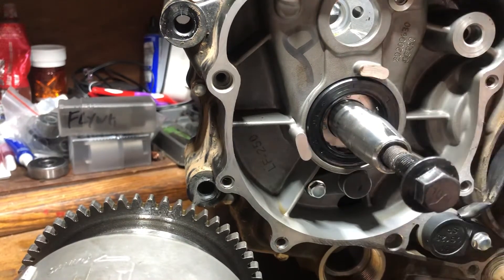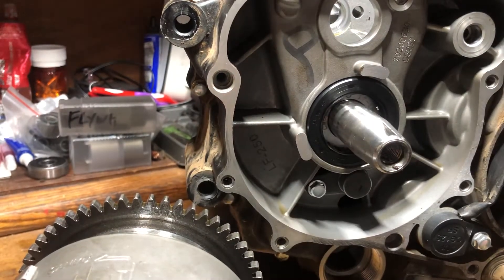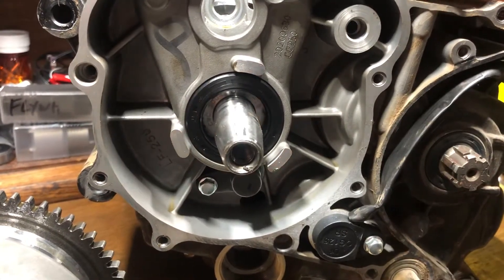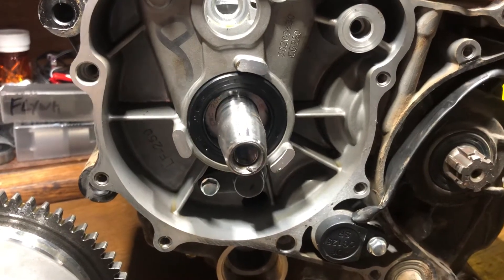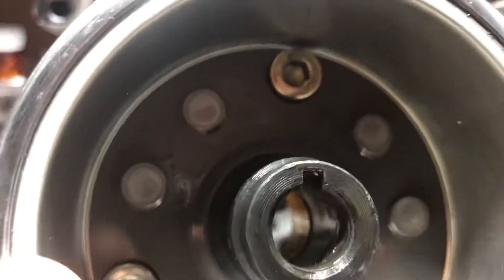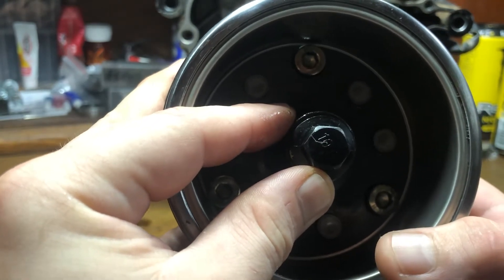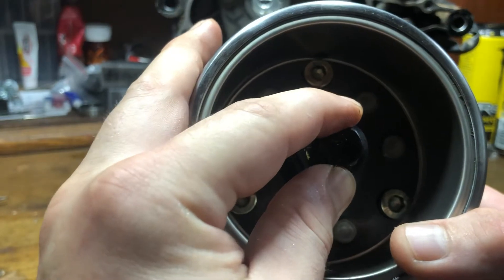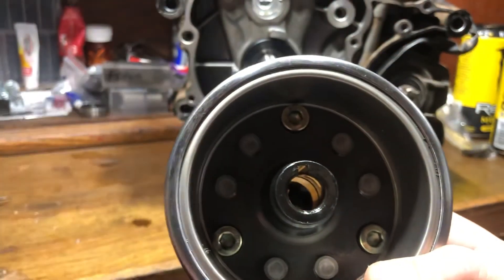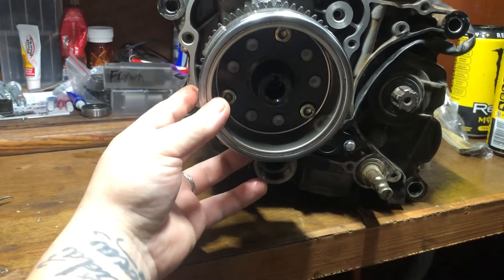I'm going to remove the key back off the crank so I don't lose it — they are really small. So if you had just pulled your stator cover off, in this case again this is a Honda CG engine I'm using for demonstration, your motor is going to be similar but different. This is your flywheel. If it was on the motor, you would have your crank bolt in there — I believe this crank bolt is a 14 millimeter. You would crack the crank bolt, remove it, and set it aside.